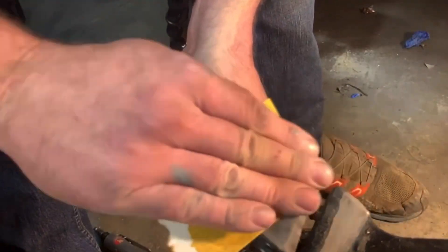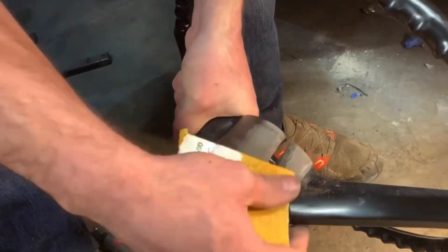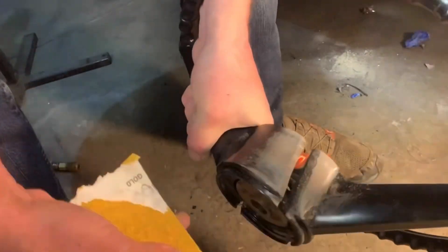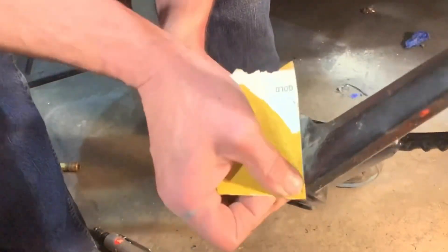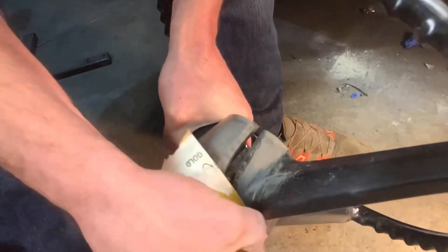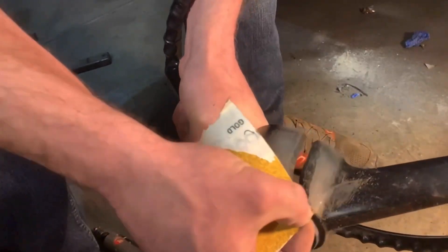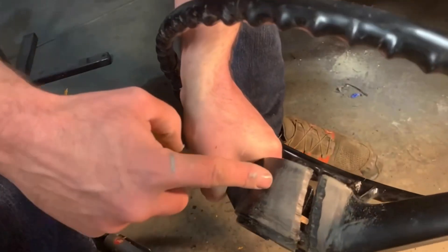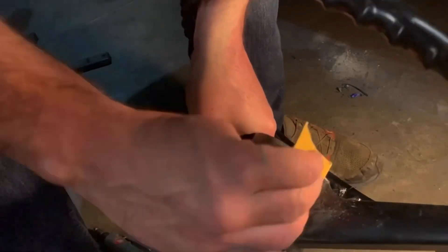Now it's all said and done, the steering wheel will be a painted steering wheel, so it's not going to be as durable as the original finish, unfortunately. Because this is all molded plastic, solid black — that would never be an issue. But there isn't any other choice, so we're going to just paint it. We're going to basically do body work on the entire steering wheel, reworking and finishing it like you would painting a car. With painting a car you can't leave a slick finish or your materials won't adhere. No more shiny stuff — it's all scuffed up and scraped up.